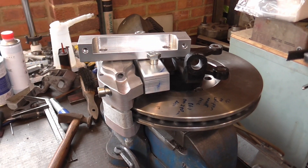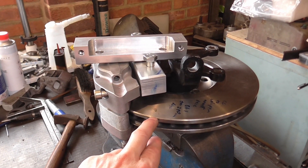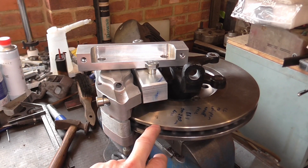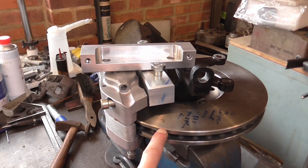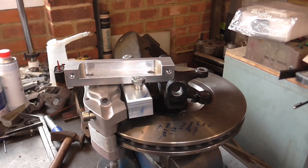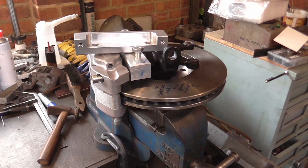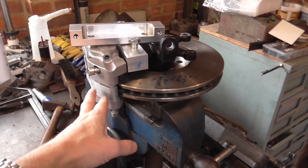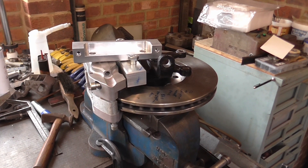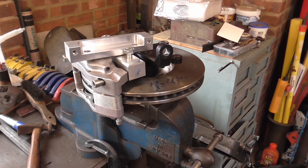I used the offset for a 280mm disc rather than the 282–283mm ones. The chamfer on the edge of the disc means the working surface is really only 280mm, and otherwise you'd end up with the pad wearing as an overhang — so I think we're absolutely fine, and they can be shimmed if needed. I'm now just waiting on caliper spares: new spacers and some new pistons, which is proving a touch difficult. I'm waiting for one of High Spec's distributors to come back with price and availability.